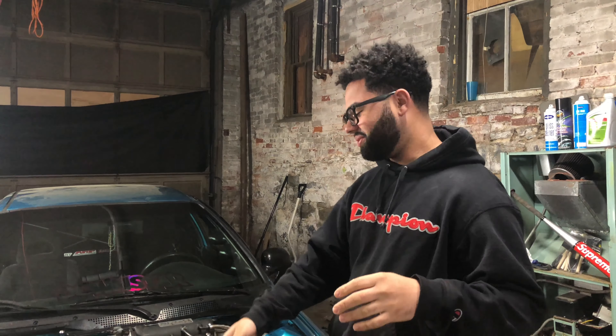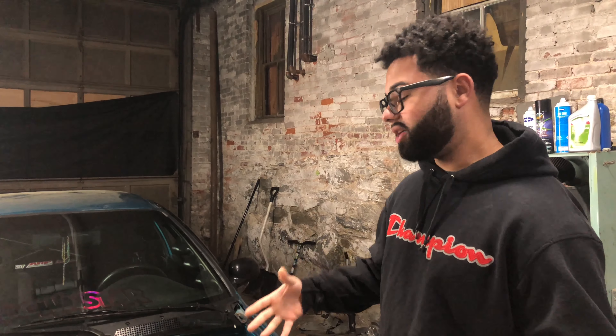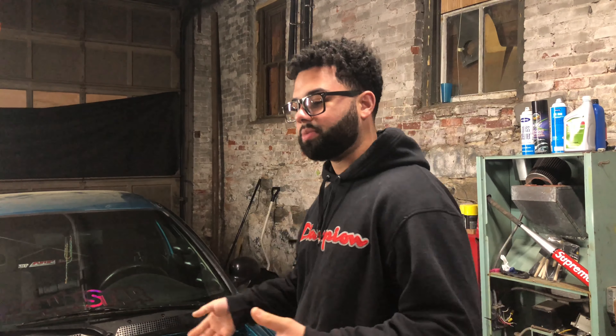So the radiator still leaks coolant and the motor still leaks oil. I replaced the oil pressure sensor but I'm almost 100% sure it's the head gasket — which I did do before I put the motor inside the car. I'm almost positive it's the head gasket. I was skeptical about putting this motor in because it was in the Integra, it was flipped over, and I didn't know if it was knocking or had a spun bearing or something messed up inside. But I know now it runs good, it runs healthy. Like, comment, and subscribe — peace.